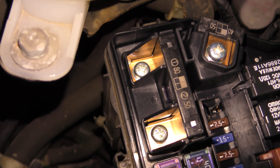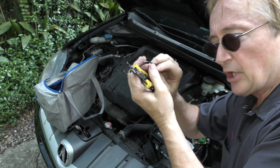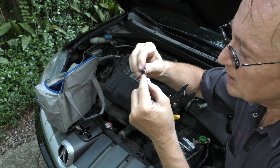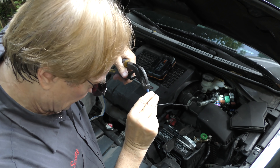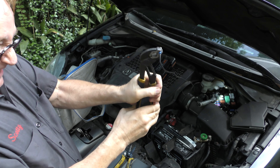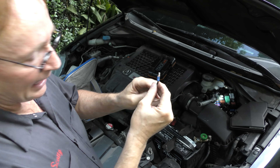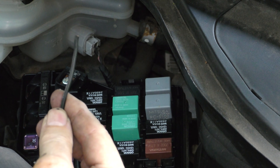As for under the hood, we're just going to put ends on these wires and plug them into the little fuse holder. That way when we connect them to the fuse box the fuse is pulled out, those two wires go inside with the switch — when you close the switch that's like plugging the fuse in, when you turn the switch off that's like unplugging it. So you can do it by just flipping a switch. Now what you do is cut off the insulation and get one of these male ends that crimps on so you can plug it into where the fuse was. Once you have it in you want to crimp it on really good — big pliers work perfectly fine. Crimp it super tight, and now it's crunched in there and it's not coming off. This end just plugs into one side of where the fuse was.